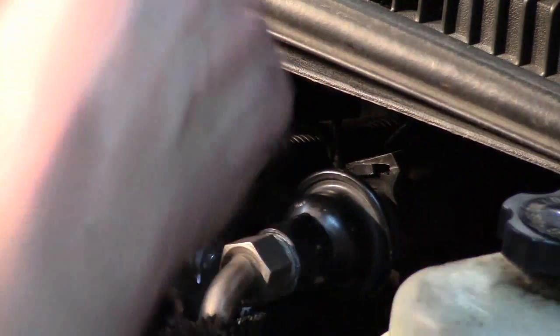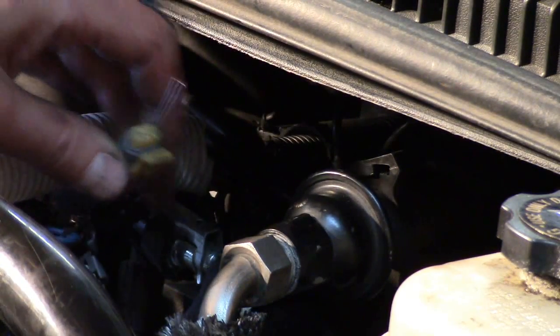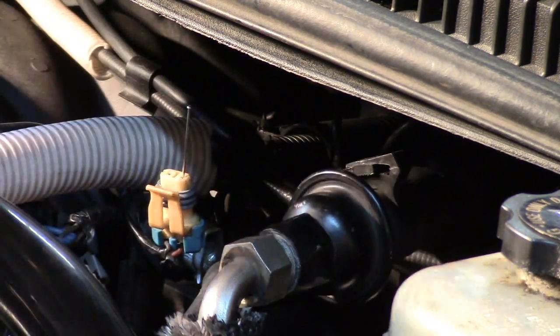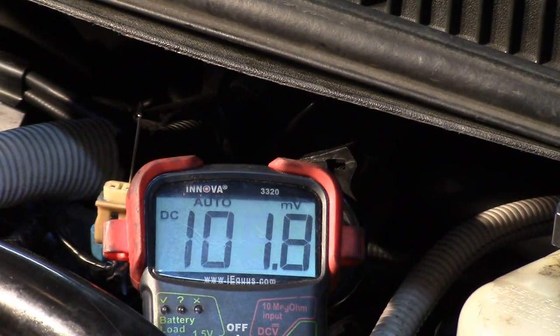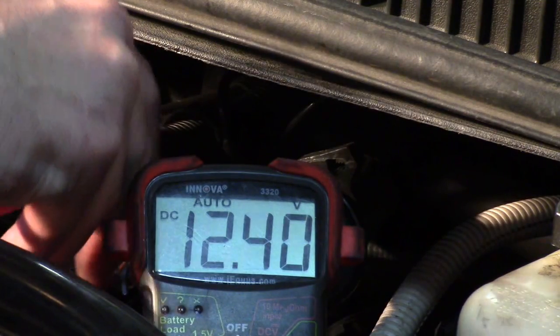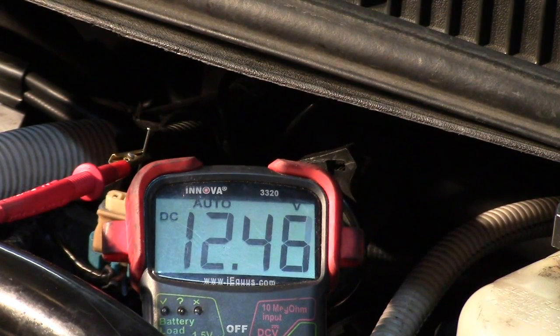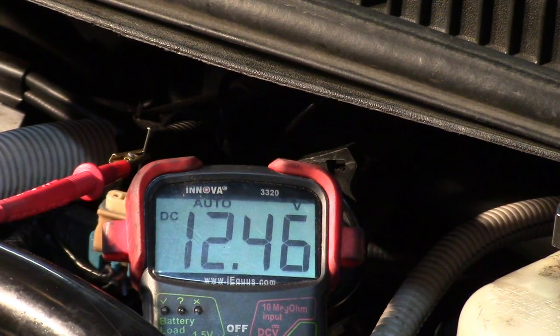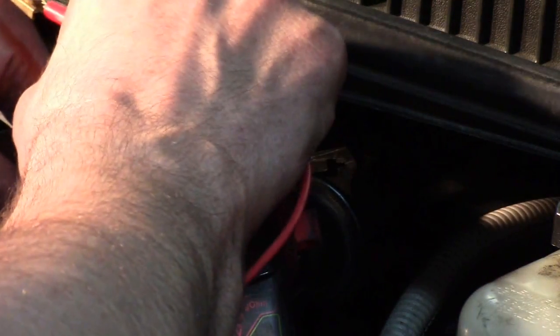For our final test, we're going to see if there is solenoid control. I believe this is going to be my power wire, so I'm putting a sewing needle in there, making sure it doesn't go near an engine ground, and connecting my voltmeter. One end goes to a good ground — I tested against battery positive and I do have voltage. Going over to my power wire, we actually have a signal already. That's because I forgot — this system is ground-side controlled. So I'm going to reverse my meter and check for continuity to ground.